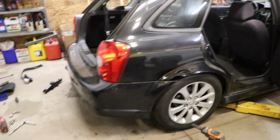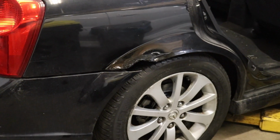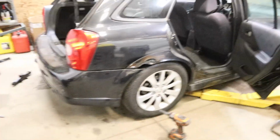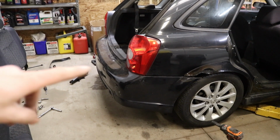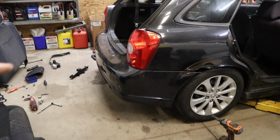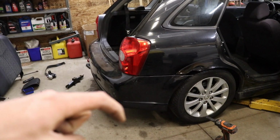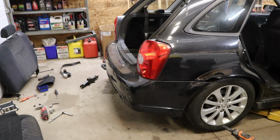We're getting close, boys. The rear bumper's on. All the top mounting positions are good except for the quarter panels, obviously, because we got a rust hole there. I did have to drill 2 holes in the metal that we welded onto the bumper beam, right where the original holes were, just so that the 2 little plastic hooks on the bumper would go into the holes and then they hook onto the bumper beam. So it's basically OEM at this point.